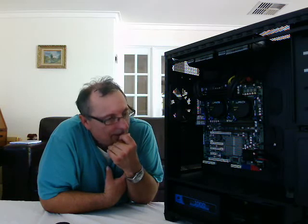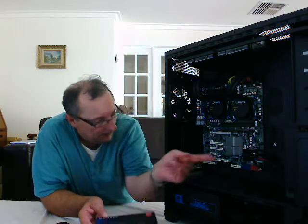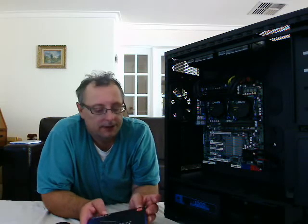Other things which I came across: once I'd connected up all the internal switches and cabling, I switched the computer on and it went through its normal POST setup and then it booted into the BIOS. However, when I actually got the BIOS screen up, it was only reading three of the four hard drives. It was not reading the hard drive in bay one. This flummoxed me quite a bit. At first I thought it could have been a faulty connection, then a faulty connection on the motherboard itself, then I wondered whether it might have been a faulty hard drive. It was none of those things actually, even though I went through all those usual checks.